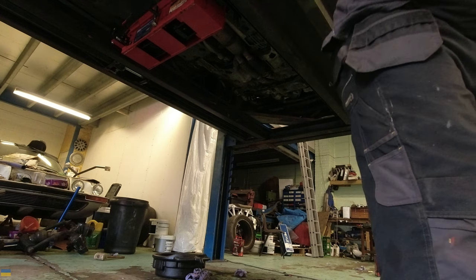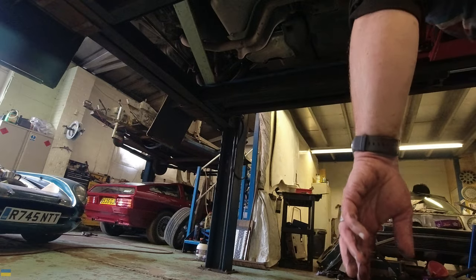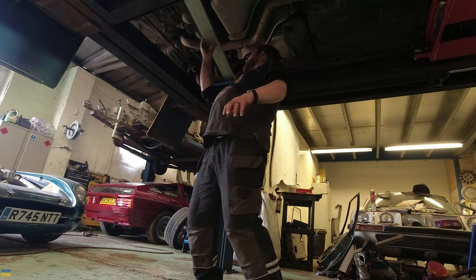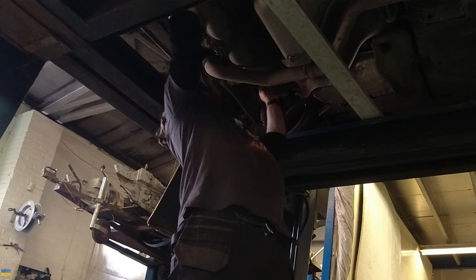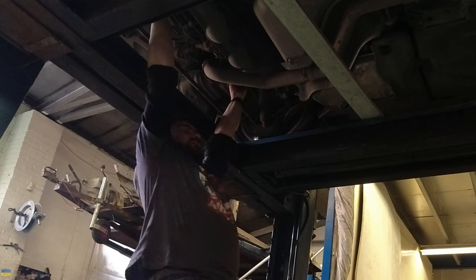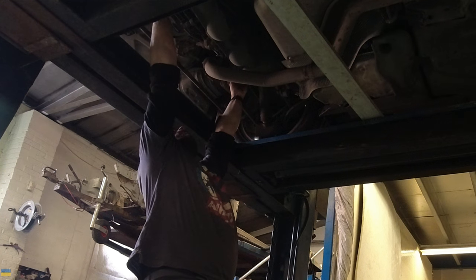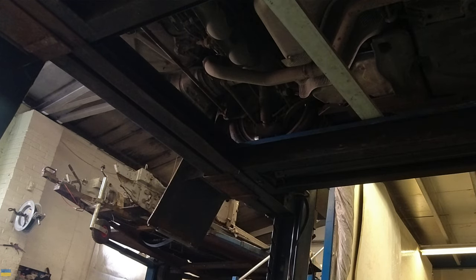Same on the back — hang on something that's part of the body, not the suspension, because that would be dumb. Suspension compressed. There it goes — it's just lifted back up and I'm going to let go. Now it's shot up a bit higher and then it will come down again. Then it'll ask me to make the measurements again — the radiuses haven't really changed, but the H readings under the car may well have done: that one changed by about four or five millimetres.